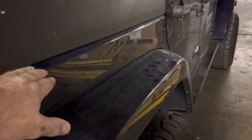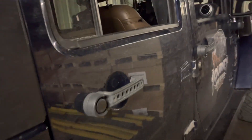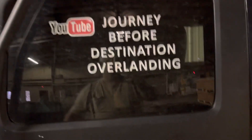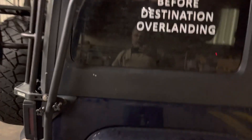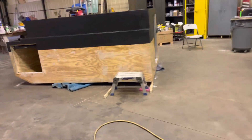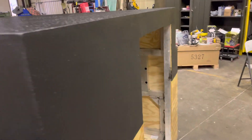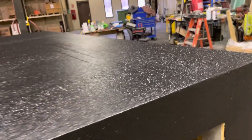Everything from the beltline down is going to get Raptor lined in blue to match, and everything from there up will still be painted. I'm also going to pull the top off and Raptor line the inside and outside of the top in black — I'd rather have it black than blue. This stuff is just crazy tough, has a very nice sheen, very simple to clean. And this is rolled on with a paint roller from the house — it's not sprayed — and you honestly cannot tell. It's absolutely fantastic.